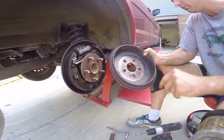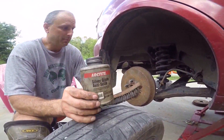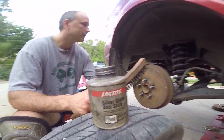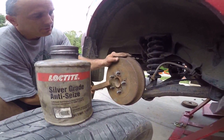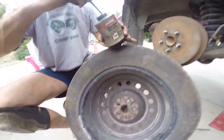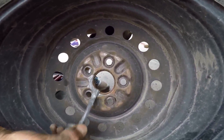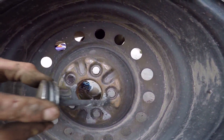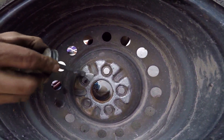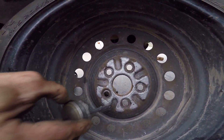Not too bad — looks nice and smooth. Here's the tip I wanted to share for when you put your wheel back on. My dad taught me about this anti-seize compound when I was young, and I use it for everything that's going to be in contact with the elements — rain, snow. Just use a rubber or wire brush in between here to quickly knock off the big stuff. Then we're going to paint these surfaces and where you see that rust building up, paint that with some anti-seize. The next time you pull this wheel off you're going to be happy you did this because it'll come right off.